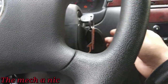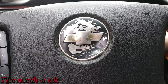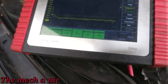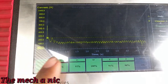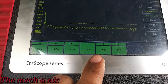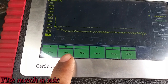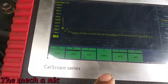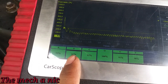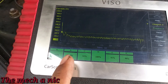I got the key in running position, pushed the accelerator pedal all the way to the floor, and cranked it. First thing you notice is it sounds very consistent. Looking at the test results — there's the waveform, no major dropouts, and the bar graph at the bottom is really handy. You can see nothing jumps out crazy. There is one cylinder that's slightly lower than the rest — you could argue maybe that's the cylinder with the slight head gasket leak, but we don't know that yet.